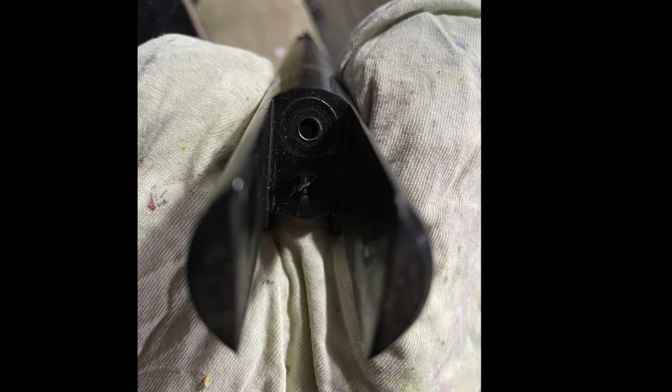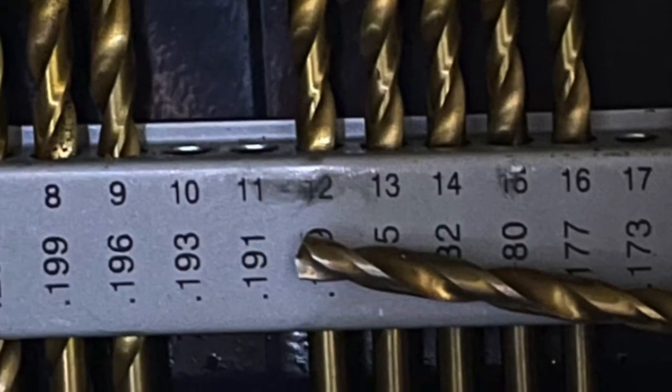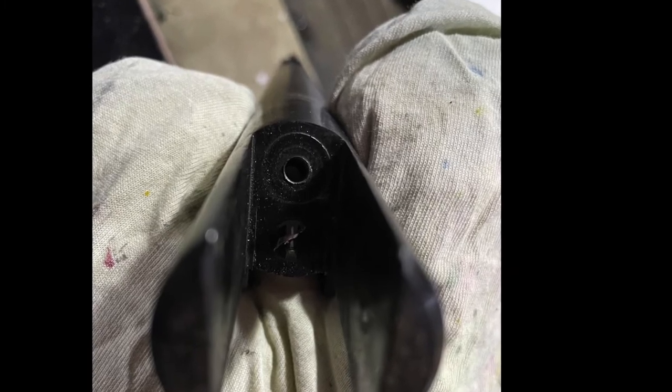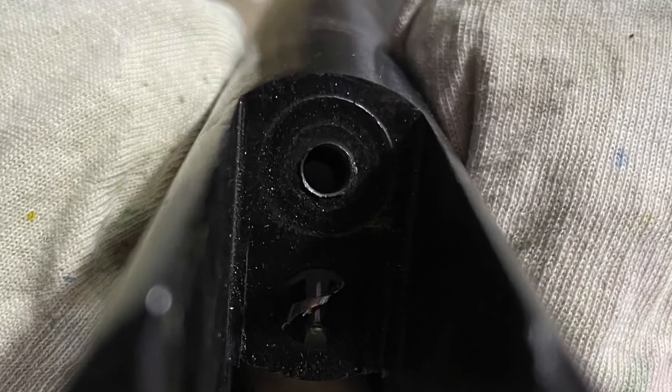Here I have the compression chamber — the main part of the gun — in a vise. I used a shirt because I don't have soft jaws, and I started at a .177 drill bit and drilled them out all the way up to 0.191. The port on this air rifle is on about a 30 degree angle, so it starts near the top and leads towards the middle. Don't drill straight or else you'll do something wrong — follow the path that the port is already on.